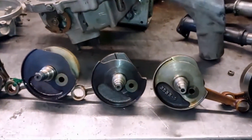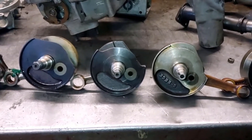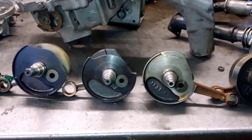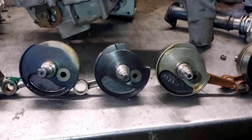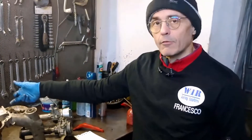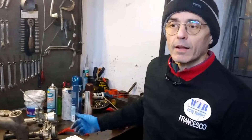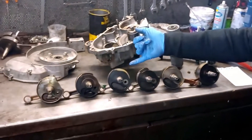Below we have the Mach-Eur, which has a phasing of a few degrees more than the HP: 118 degrees in advance and 42 degrees in delay, so 160 degrees overall. This shaft is also very suitable for a 100cc, because having a lot of advance allows you to work the valve. On the delay side, without touching the shaft near the crank pin, you can easily get from 42 to almost 60 degrees of delay.